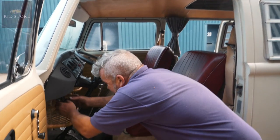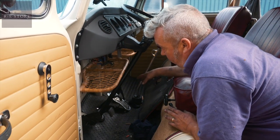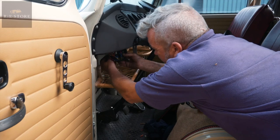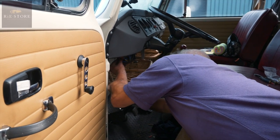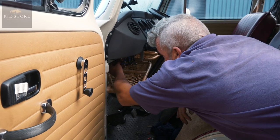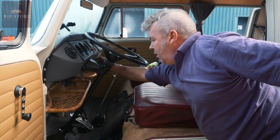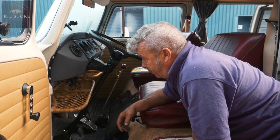So that wire, I think, is chafed from front to back. If we just test it now — ignition on, nothing blows. Start now, we connect that to that, put your foot on the brakes — fuse is blown, and I can feel that getting hot. So I would say there's a direct short somewhere on that wire.